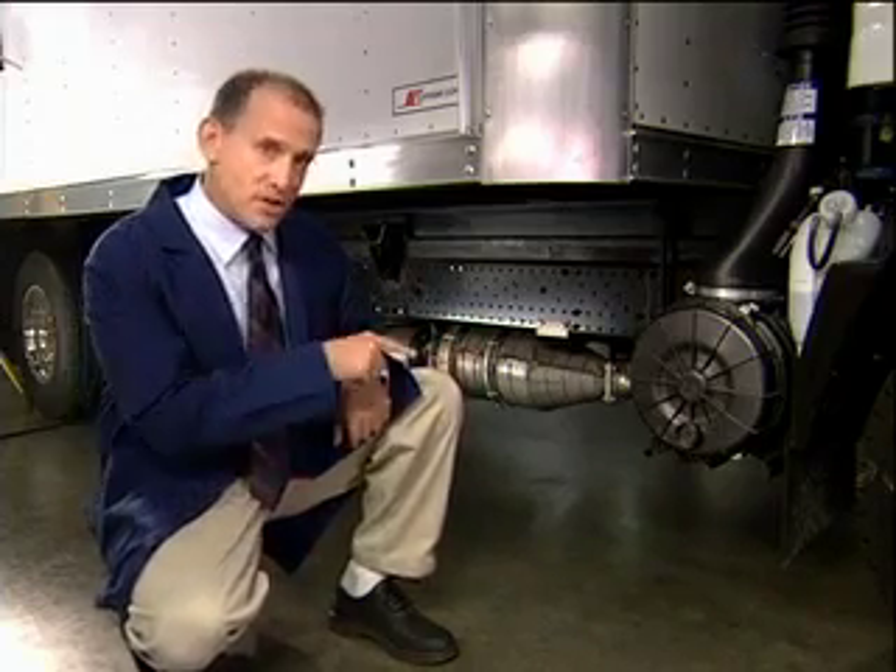But there's a big difference between this air filter and the exhaust filter. You can replace the air filter quickly and economically. The exhaust filter? You can't. It's a sealed system, so it has to be regenerated — that's just a fancy name for cleaning.